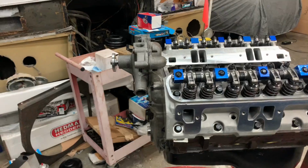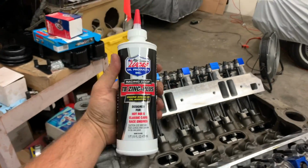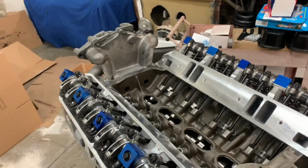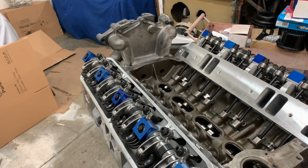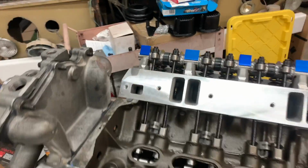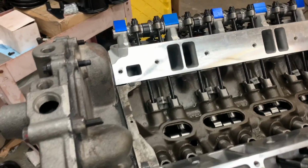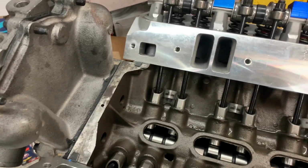First things first, even though it's full roller, we're still gonna put the Lucas zinc additive in it. Get this baby ready. Gonna put some oil in. Going to prime the oil system before we put the intake manifold on. That way we can watch all of our lifters. We can actually turn her over a little bit by hand. Make sure everything is as it should. And then we'll put on our manifold